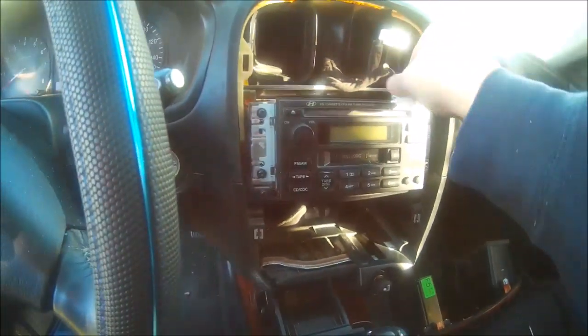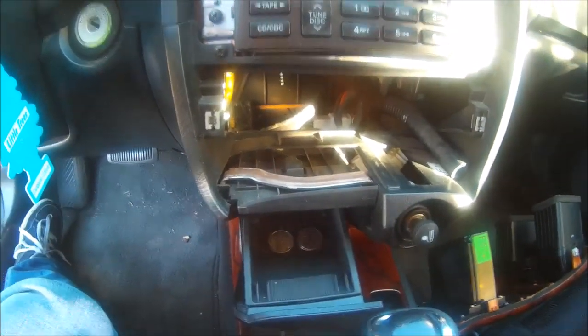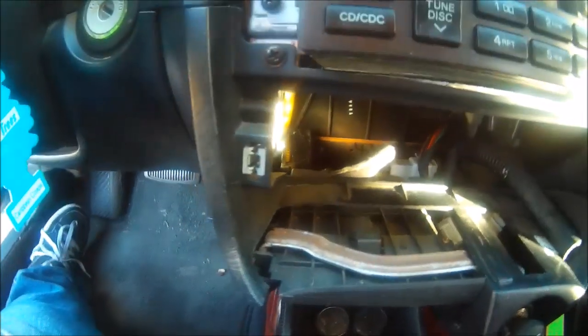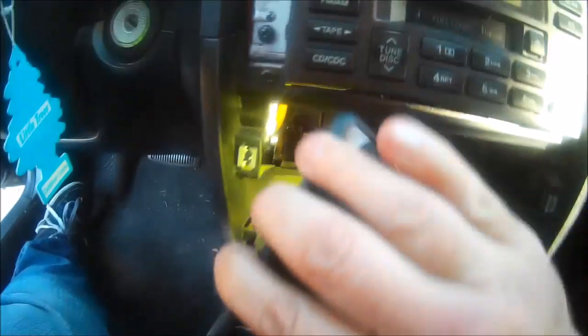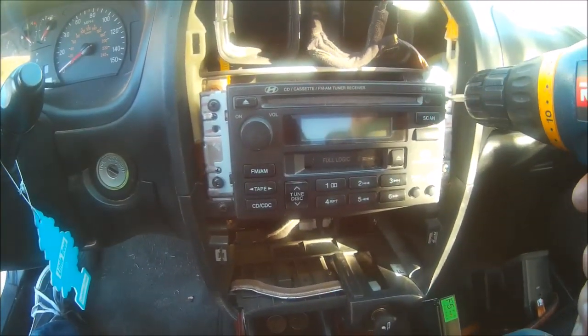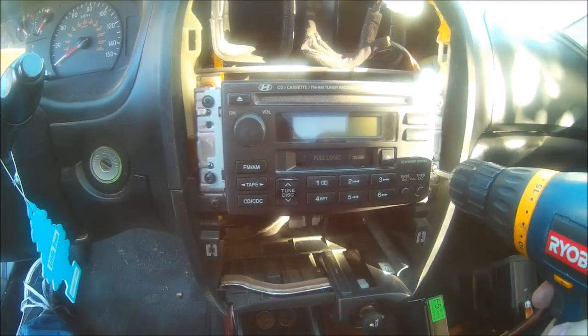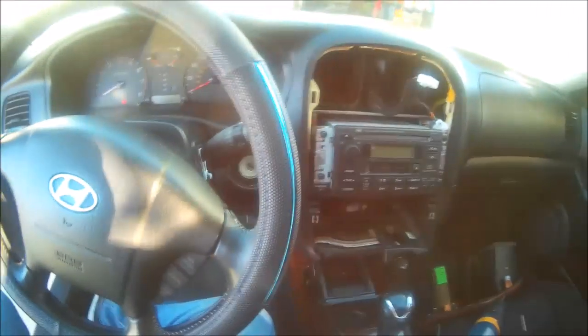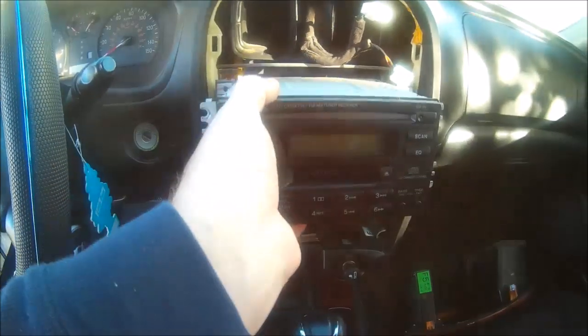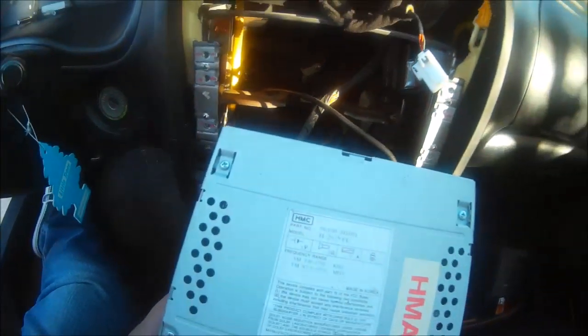I decided I am going to remove the stereo. I really didn't want to, but it's too hard to get into that little hole where your heater and air conditioning vent is, and I don't want to break that box. It's simply four screws here. I'll pull those out and then there's a wire harness on the back. Now that all four bolts are out, there should be just a wire harness back here and then the other one's your antenna. Just disconnect those and we'll have more light to see the little black box.